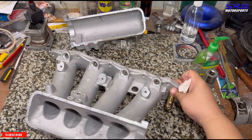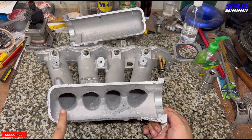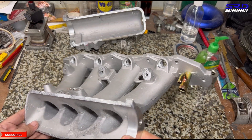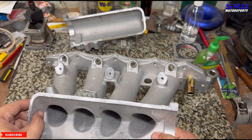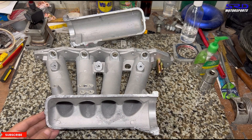As you can see on the entry, there's a bit of an abrupt corner on the circumference or perimeter of the runner entries. This is easily ported, so that's no problem. And look — the wall is quite thick, which is good news because it lets me shape it even better or how I want it to.